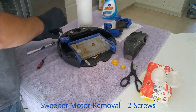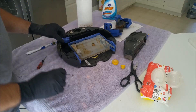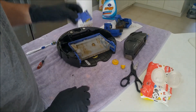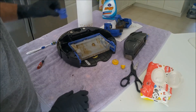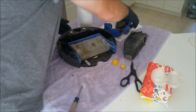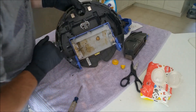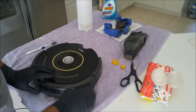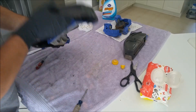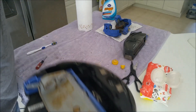The sweeper motor has two screws — one here, another here — and it just lifts out. It works on two spring contacts, much like a little AA battery, so you need to make sure those are clean and that you're not getting them soaking wet. Likewise, in the wheel well assemblies there are plug connectors — you need to be careful of those. At this point I'm just going to give it a gentle pat to try to remove some of that material.